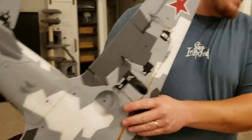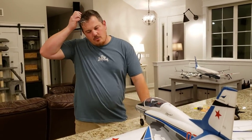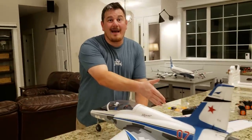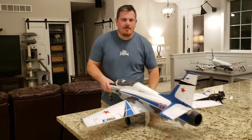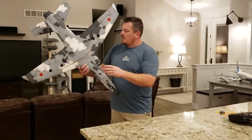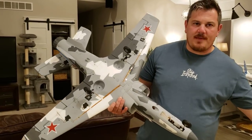My thought is if you're landing and it rubs on the left side and not the right side, then it could yaw the craft and it could cause a little bit of an issue. I don't know if that's gonna be an issue. I think more than likely what it's gonna do is just slow the plane down really quick because that wheel might bind, this wheel might not. But I feel like they're still in line enough. And you see there's some resistance there. And if I get it in the right position, I just feel like you're never really gonna be in that position where it's gonna be just one side or the other. So anyway, that's my take on it. Like I said, this came on high recommendations from a bunch of different people that have done it.